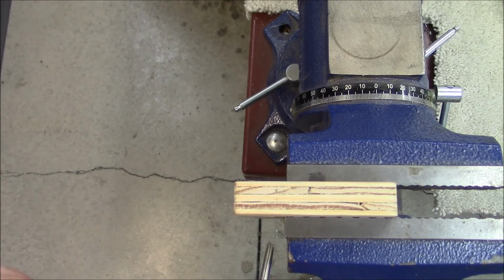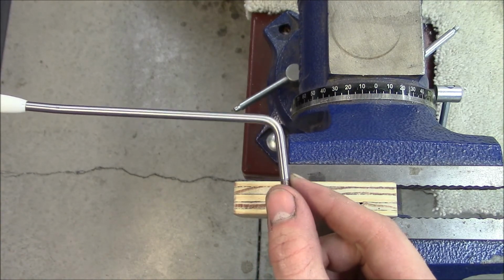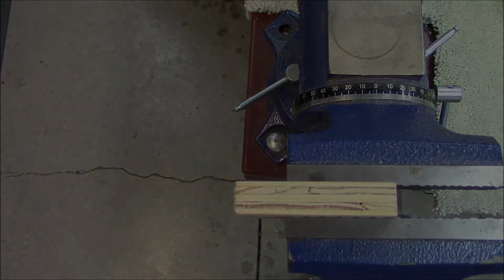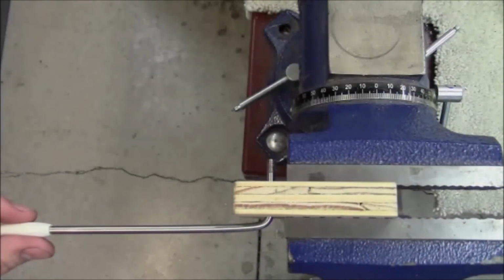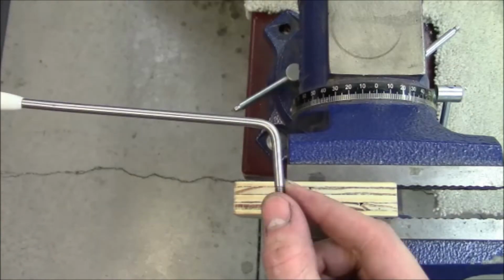All right, should give me plenty of clearance now. I'm going to pop this back in the body and show you guys what we've done. Let's go back to this freeze frame real quick. You guys will notice that I have the arm pushed all the way into the jig that we have. That way I don't risk bending the vertical portion that actually passes into the block. That way we get totally normal arm function when I go to put this thing back in place.